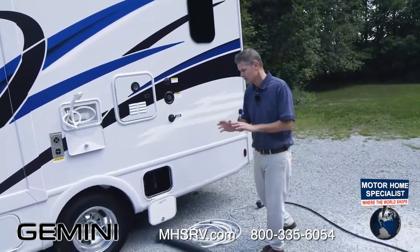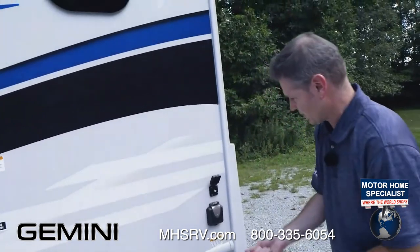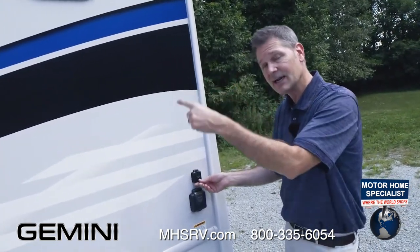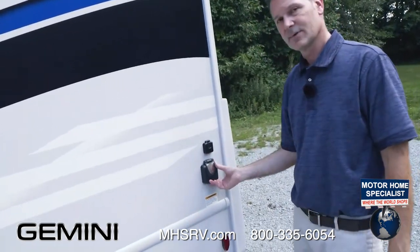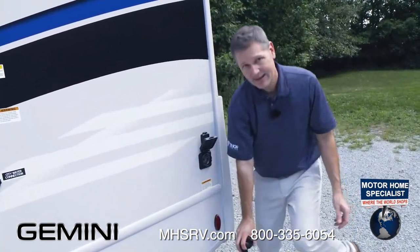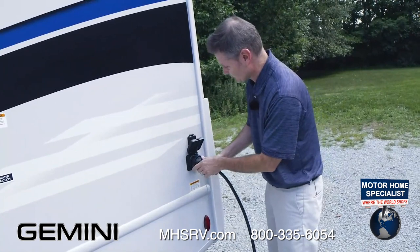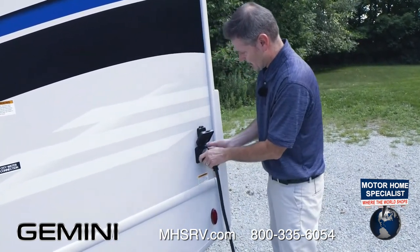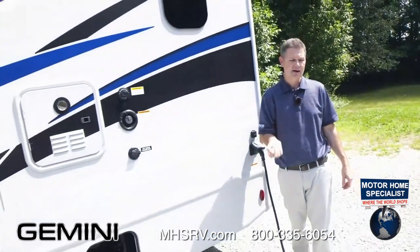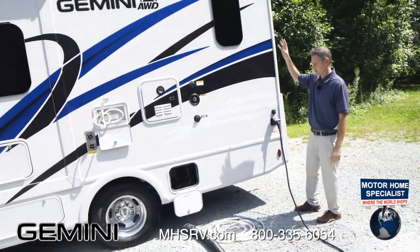We're going to hook up and set up camp — plumbing, electrical, everything you need. If you love TV, you can connect cable by plugging in your coax right here and running it to the campground — the cable connection is in the same cabinet as the HDMI plug. But you need power. Rather than run the generator 24/7, let's get 30-amp shore power. The plug is detachable so you can keep it in any bay you want. Line up the pegs, twist the lock on, go to the receptacle, make sure breakers are off, plug in, turn your receptacle on — and in seconds you'll have power to your Gemini. A transfer switch determines whether power comes from shore power or the generator; you'll hear a microwave beep when it kicks in.